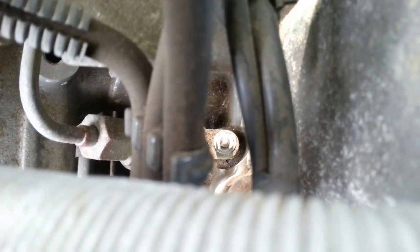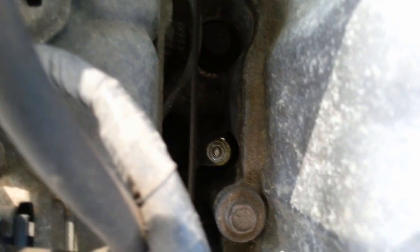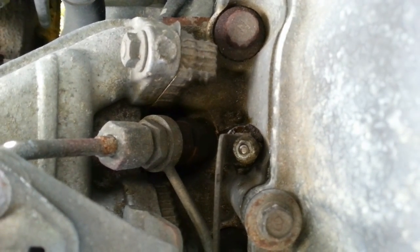The engine in the pickup has four glow plugs — that's one per cylinder — and as it's standard practice to replace the full set, that's what I'm going to be doing today. The only thing I've done previously is spray them all with a bit of penetrating fluid, just to try and make my life as easy as possible.